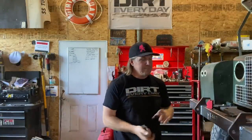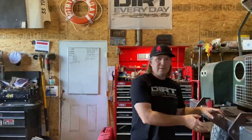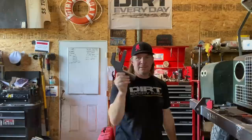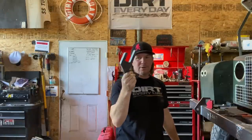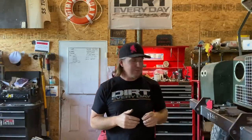But it's got to be a good one, which brings up a whole other situation. This bumper is made out of 3/16ths material. This hook is 5/8ths. So you've got thicker material welding to thinner material. How do you do that? I'm not a welding instructor, so take this with a grain of salt, but I'm going to tell you how I do it and also ways that I have researched doing it.